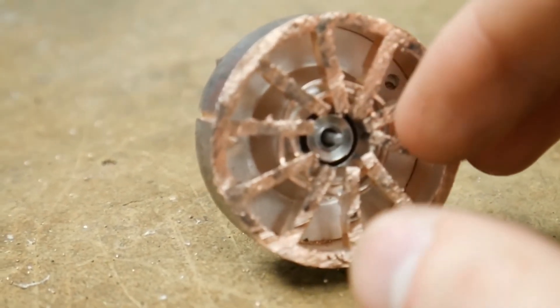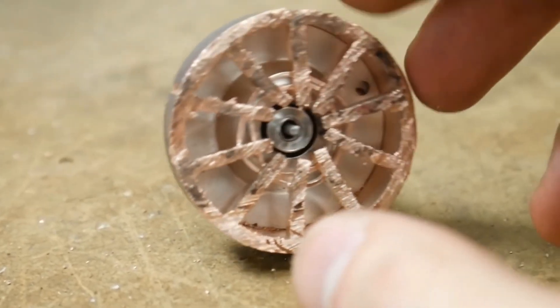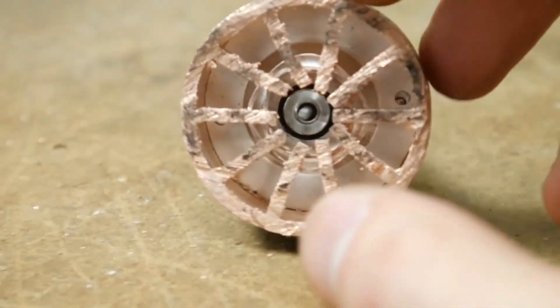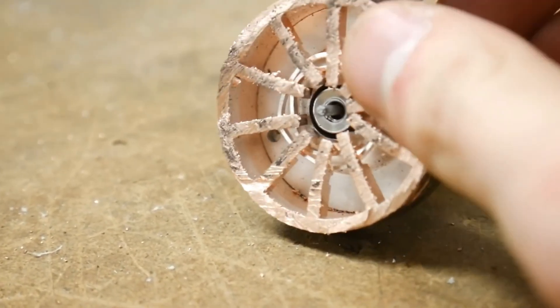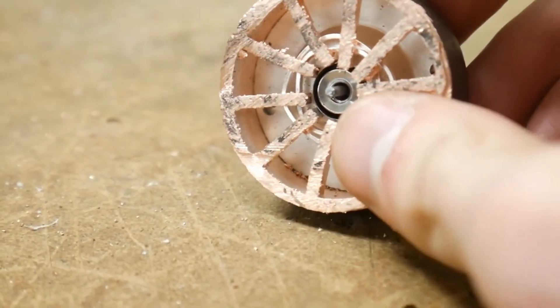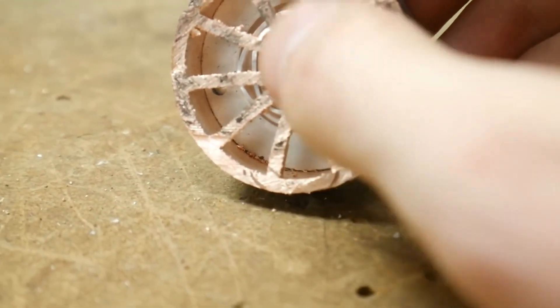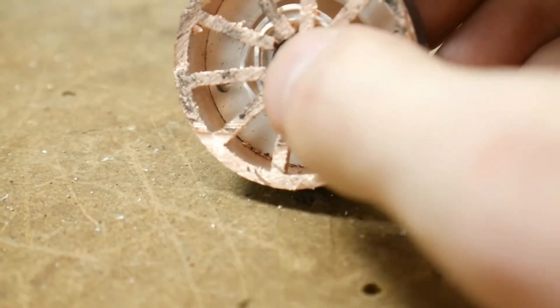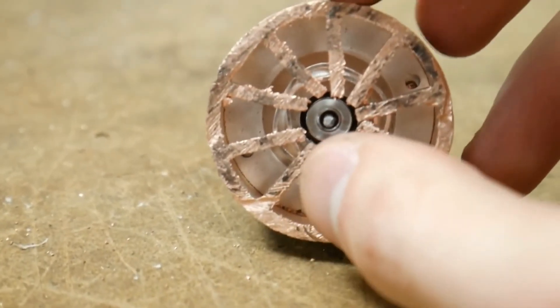We see that the inside is made out of copper, which is not what I was expecting — I thought it would be made out of steel, which would be a much tougher material. This actually wasn't too bad to cut through. That center rod right there — that's the filament where the electrons are ejected from. That's superheated, by the way, so that the electrons can migrate away from it into the cavity.